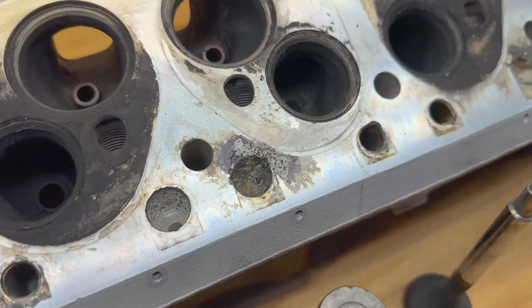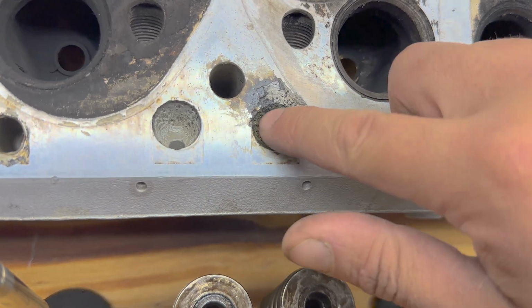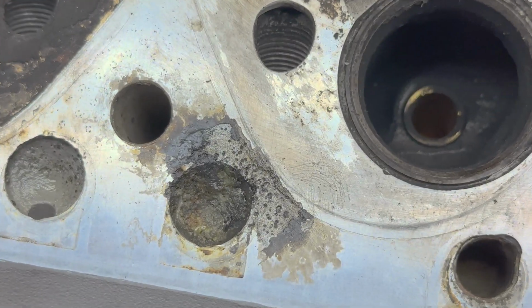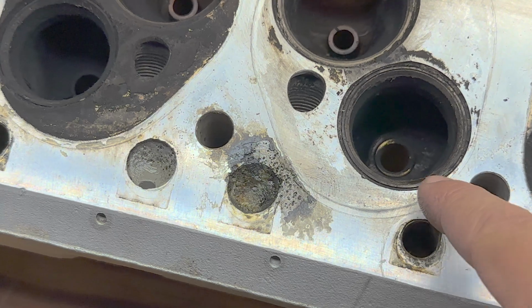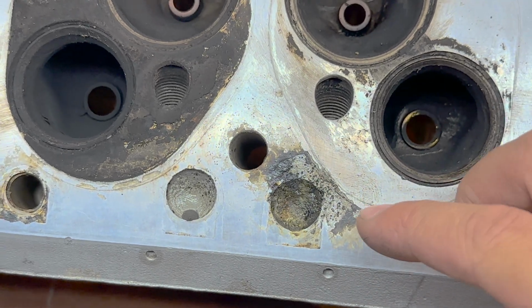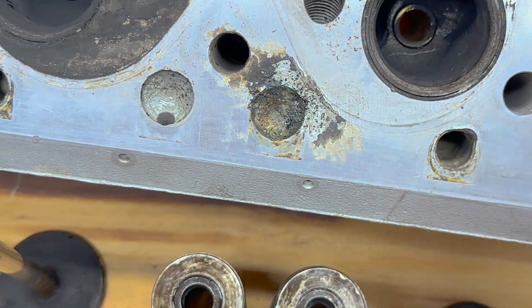That's no good. Found your water leak, and I was literally just scraping off this rusty, crusty garbage here and found that track from, I want to say, corrosion, erosion, but really I think it's cavitation because this is supposed to be a steam port or a cross drill for water to flow, but when it gets plugged up with whatever this nonsense was,